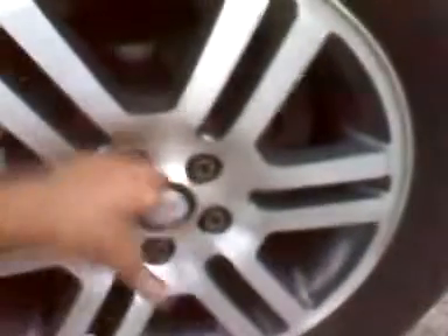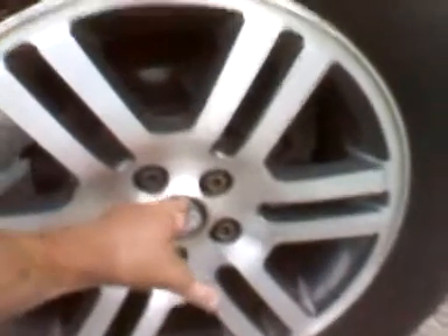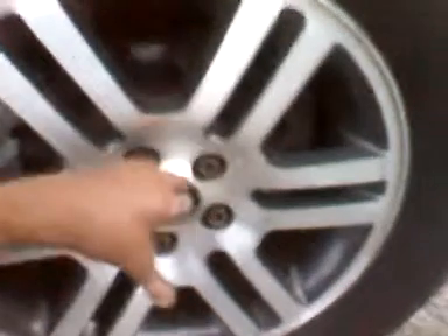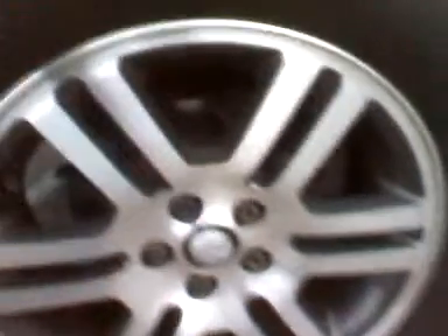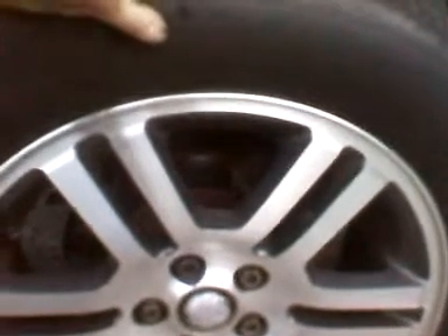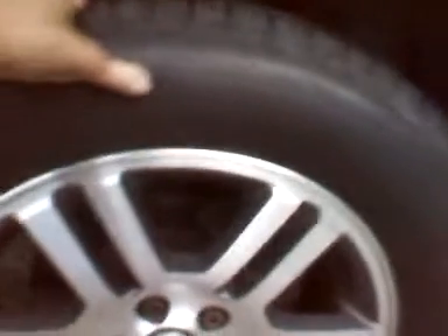In the front I had to do a wheel spacer because when you put the rim on the hub, where the hub comes back to the rotor it has a lip on it and the wheel wasn't sitting flush against the rotor. At least that's what the tire shop said, so I went and bought some spacers and threw them on there. Now the rim is on there, it's tight, it's down on the ground.